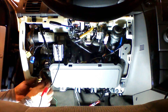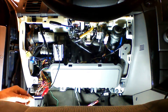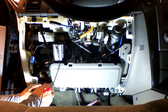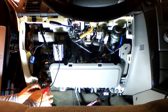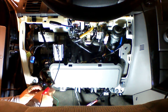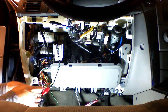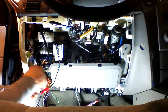There are our three PosiTaps. We're going to connect our solid purple wire to the lock wire, our purple-white wire to the unlock PosiTap, and our yellow with black to the rear hatch release PosiTap. Tighten the collar, give it a pull test, and plug the black plug back in. Don't forget to plug it back in — a lot of things will not work if you don't.